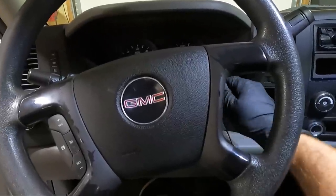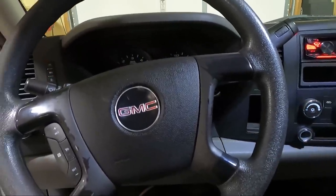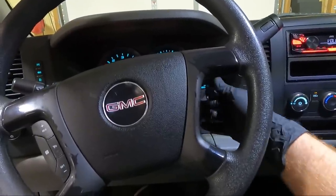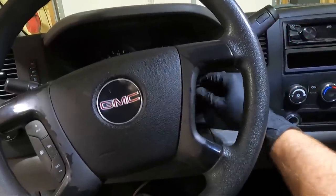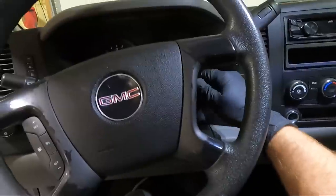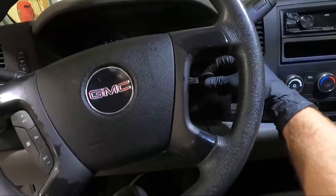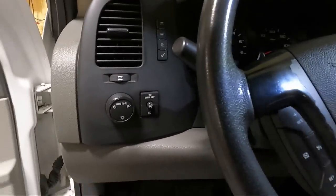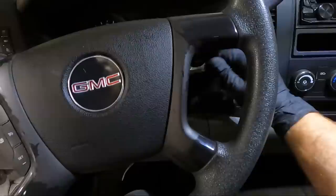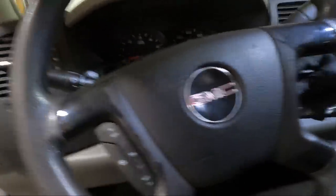It's interesting — let's see how that one starts it. There we go, it just takes a second to program. The other key works better; this new one fits better. I think maybe we can just file it. We may have to replace an ignition — since we've already done this we may just have a hang-up in the ignition switch. We'll see down the road. The buzzer still going off makes me think there's something wrong with the ignition.